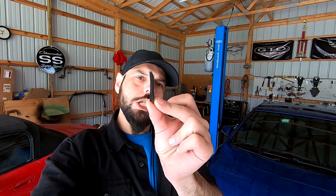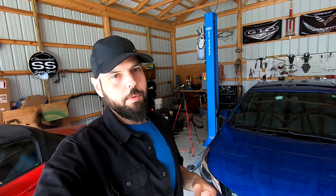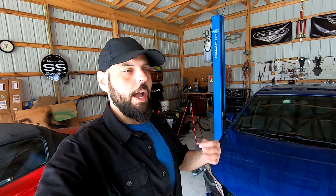Back in the garage — when I first took the car out I had two pieces of foam doubled up and that worked great. Later on on the way back I ended up taking one off and just using one. You get the point: either stopping the throttle or adjusting the throttle position sensor will fix the boost wall problem. My car would hit 30 pounds of boost in first and second gear no problem, but in third, fourth, and fifth I'd always hit that boost wall around 15 PSI. Today, changing the throttle we were able to get over 25 pounds of pressure.